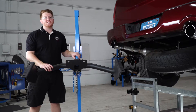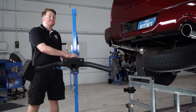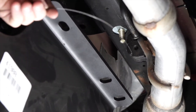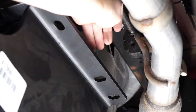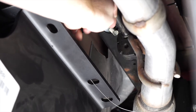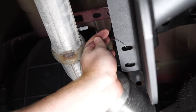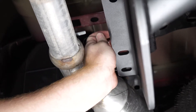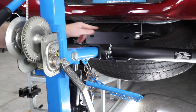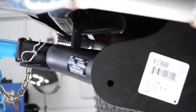Now we're going to bring our hitch into position. We're going to be using our U-Haul exclusive hitch jack. If you don't have a hitch jack, we do recommend that you get an extra pair of hands since this hitch is a little heavy. As we line up the hitch, we're going to take our fish wires, starting on the passenger side, and put it to the second to last hole. We'll repeat on the driver's side. These two holes in the middle of the hitch will line up right behind the support behind the bumper.